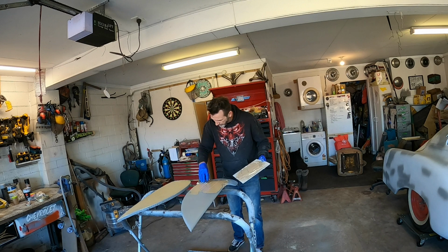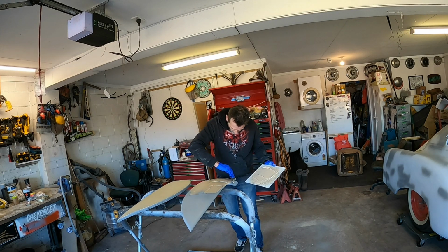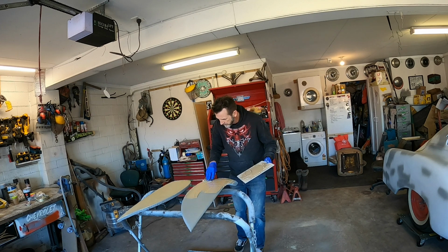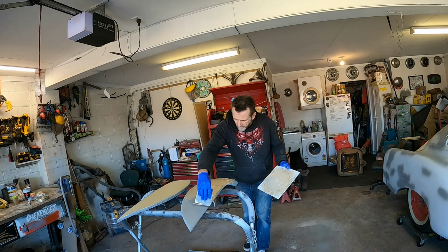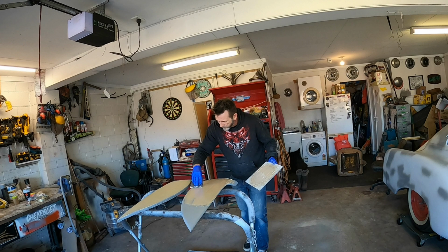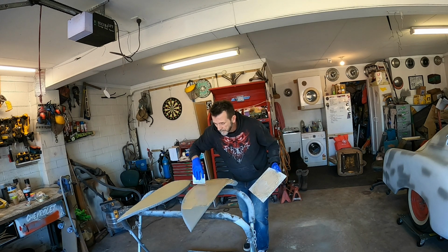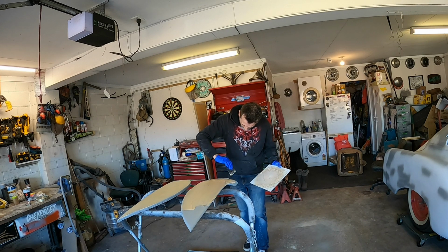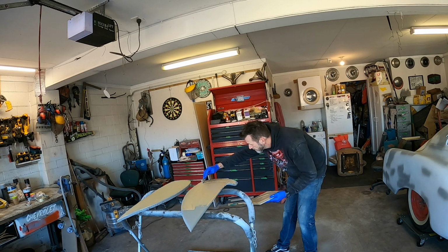My biggest issue is bubbles in my Bondo, slime, mud, whatever you want to call it. And this particular brand, or type of bog, which is a U-Pol, I seem to get way more pinholes in it than I do with the other brand I was using, another U-Pol one, U-Pol Dolphin. I was having quite a good time with that, but they didn't have any last time I needed some, so I got some of this U-Pol Fantastic, and I don't really find it that fantastic. Could just be user error, quite likely. I have seen reports of other folk having similar issues with it that I have, so could just be all of us or just me. I don't know what that means.